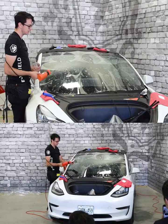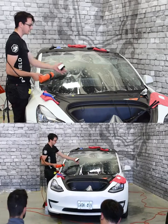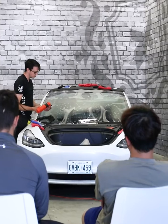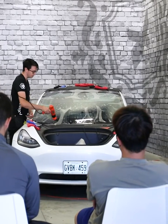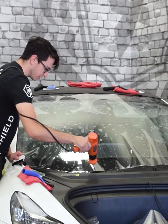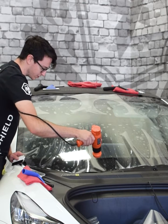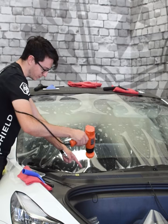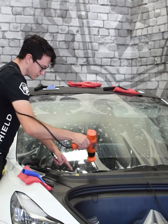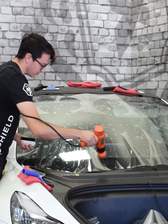The most important step is to get the film to a gelled state so that it's soft. Whenever you watch a video of somebody shrinking exo-shield and you see them push the hard card through the finger, it's nerve-wracking because generally when you do that with something like window tint, you're going to crease the film. But if we get this film to a gelled state, we're going to heat that bottom edge up, and the pressure of the air pushing on the film is going to get it to fold. That's how we know the film is in a gelled state.